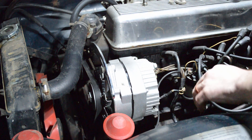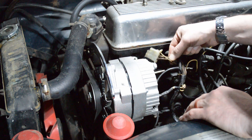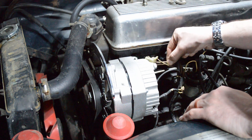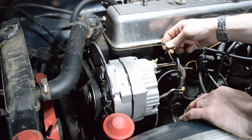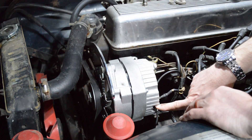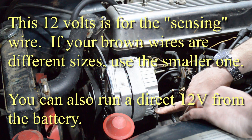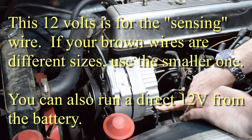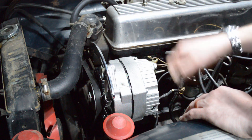If you remember, we've got this plug. There are two big brown wires. According to the wiring diagram, these are connected at a plug in the wiring harness. You've got your indicator wire — it's the brown one with the yellow stripes. The indicator is going to go on one terminal here, and there's going to be a positive 12 volts on the one next to it. As you're looking at this alternator from the back, the indicator will be on the left and the 12 volts will be on the right. And then you're going to have a positive wire for the output of the alternator — it's going to go on this lug on the back.